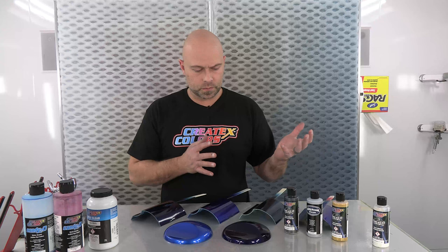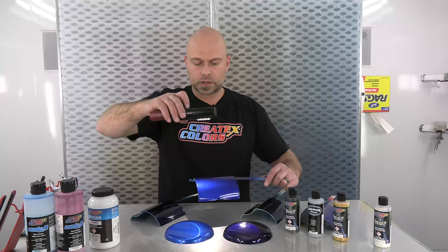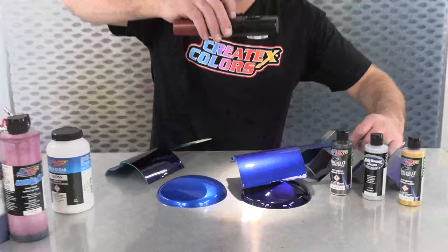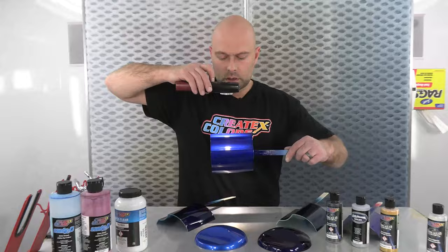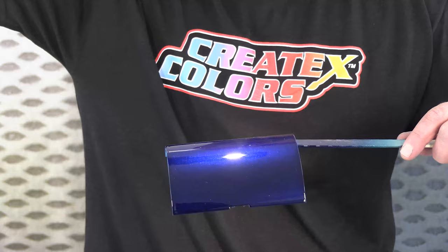Welcome back. The clear coat is totally dry, so we'll take a moment and recap. We have in front of us the two reference samples from the beginning — the Carib Blue and our Ultraviolet. We want to show the contrast between what we mixed — the Blueberry — versus those. Blueberry versus Carib Blue, all over silver sealer, four coats. The Ultraviolet is definitely darker than the Carib Blue and definitely more blue than purple. So Blueberry sits right in between. Then we have the Blueberry over charcoal metallic — same color, just darker. Pretty much the same color, just a darker version of it. That metallic charcoal is great for a deeper, darker base because it is so clean.